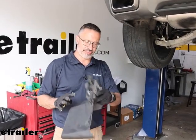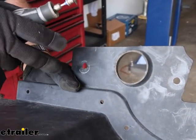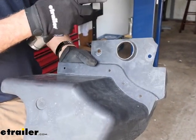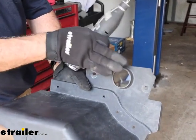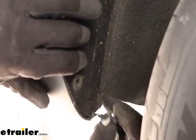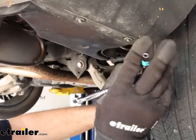The last step is to replace the plastic panels on either side of your car. This isn't in the directions, but we ended up using a Dremel tool to cut the cap off of the panel. A lot of people may not have a half-inch drill bit, and it has to be exactly in the center. Having a cap on it really doesn't matter anymore since our hitch is up there blocking everything on the inside of the frame anyway — so it's just easier to cut it off. You can use a Sawzall and just trim the cap off. This way you won't have any fitment issues when you reinstall it. Take the pushpins and snap them back into place. Do this on both sides and you'll have completed your installation.